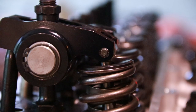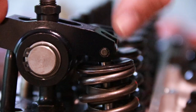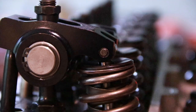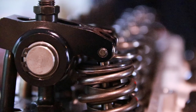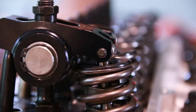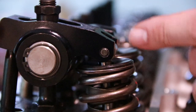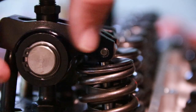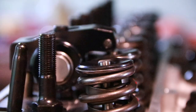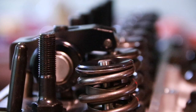As another example, this is another push rod I have that is significantly too long. As you can see, the rocker is already tilted down. So as I crank it around, you'll see almost all of the sweep is going to be pulling back towards the intake. This is also far from the ideal stress carrying capabilities of the rocker arm, where it's way past center that way. And it yields an even wider patch than with our too short push rod.